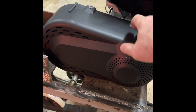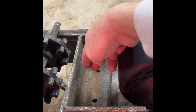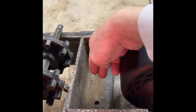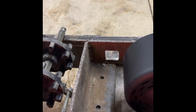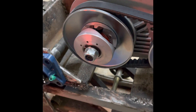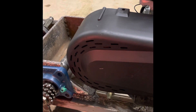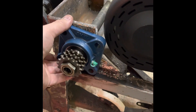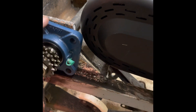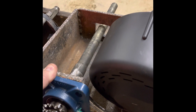I've got this cover on — let's pull it off. Right behind the secondary clutch there's a little 12-tooth sprocket. I plan on running probably a 35-tooth sprocket here on a 3/4-inch drive shaft jack shaft, out to another 12 or 14 tooth. I've trimmed this out a bit so the clutch cover will fit on. This is the shaft that'll go on there but it's too big — it's an odd size. This is the old jack shaft up at Snowville.